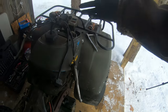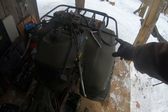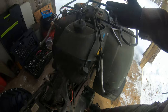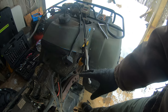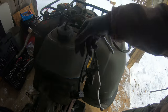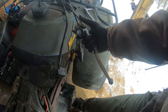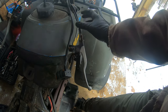As I took the handlebars off - I had to take the bars off to get that cowl off - so that I can get the front plastics off, ultimately so I can get the rack off. I still have to disengage the high-low, then I can get the front plastics off, then I can get the tank off, and then we can start to see what's going on underneath here. I've put the clamps for the bars back in where they came out - I just like doing it this way instead of a bag of parts.